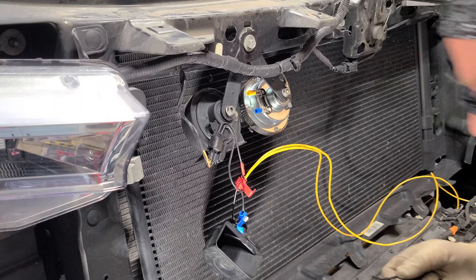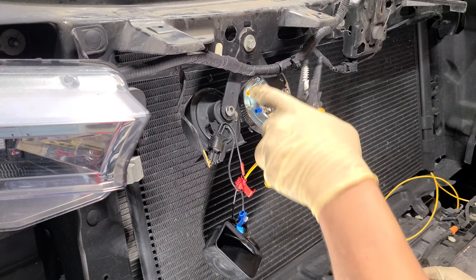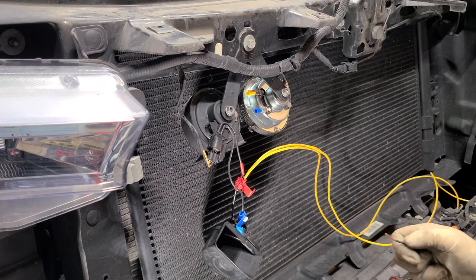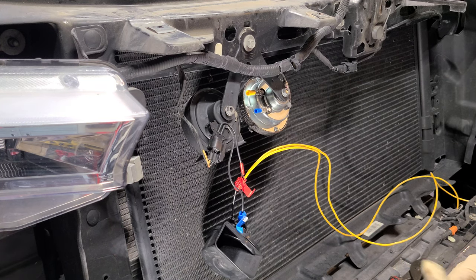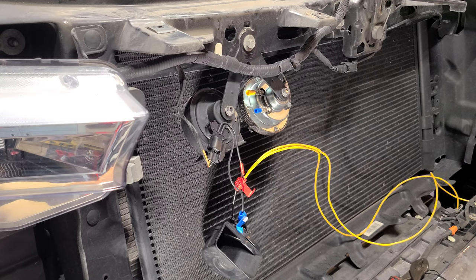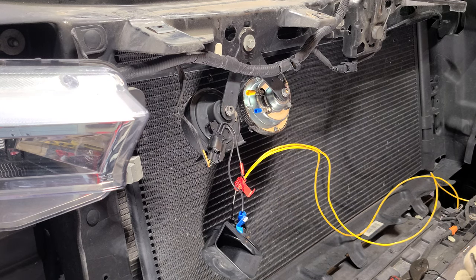I'll show a little bit on camera. We're going positive two-wire and we're going to tap in here. I'm about to make a nice setup — this is all custom. I want everything nice and crispy and to work forever. Wiring up, getting ready to do the same on my negative. Make sure you have more than enough wire to stretch across — and we do. I did yellow for positive since the factory horn wire is yellow, so it's easy and won't get confused.